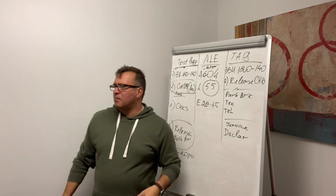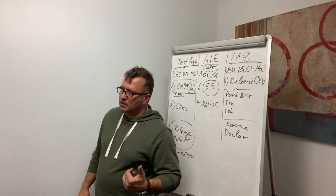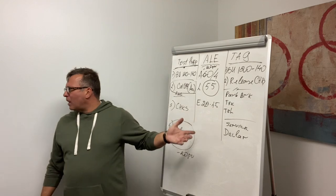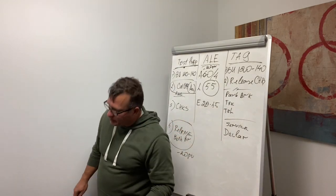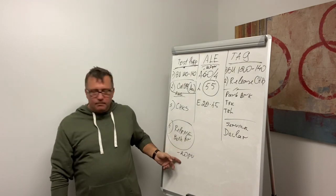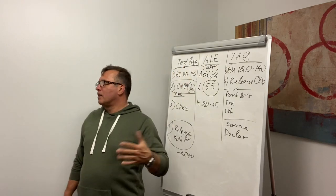You're still explaining, my system didn't lose more than 4 psi. If you're being asked, wait a minute, reading right now is 80. Yeah, it was 120, so why is that? Then you explain. Then yes, ma'am or sir, that's how it works. I use my pressure when I release the brakes. Now when I apply it, I lose another 20.